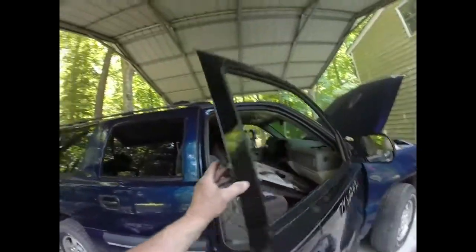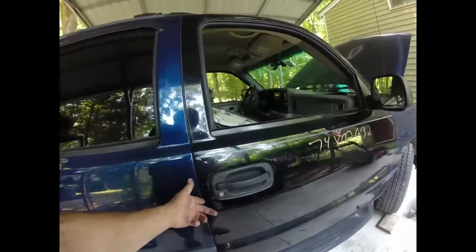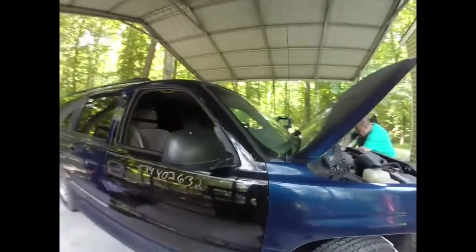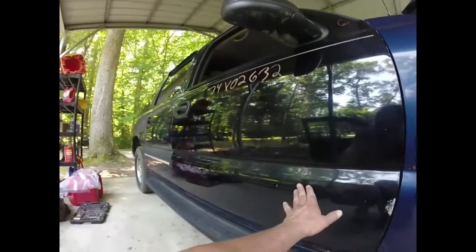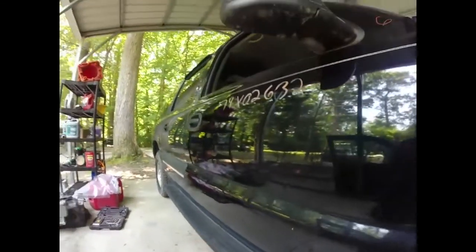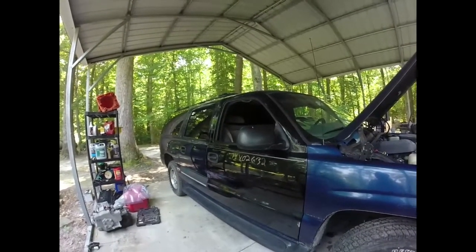We just did a test — shuts like it should. Gaps are the same on this side as they are on the other side. I was a bit concerned because of the large gap here and then it gets tight at the top, but it's the same way on the other side, so obviously that's the way GM decided to make it. I've got the mirror on. We think it looks better without the molding than with the molding on there — kind of leaning towards just pulling it off. We do got to fix this little ding here, no big deal.